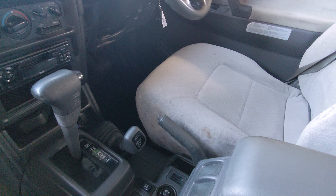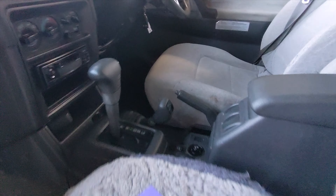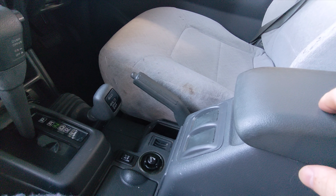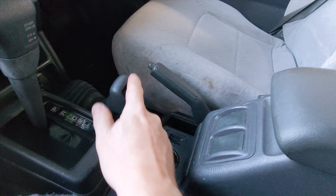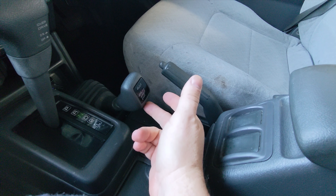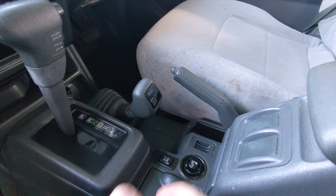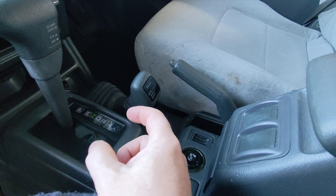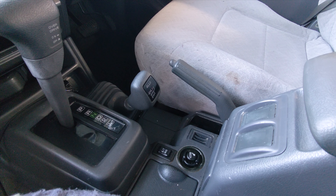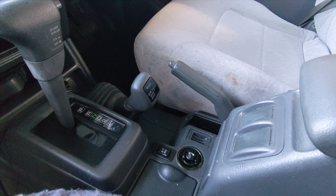Facts about this car — the important things. It has never, ever been in four-wheel drive. So I took the car for a test drive, and the old fella who's 85 years old — the first thing I did was test that four-wheel drive engaged, because as you Pajero owners would know, it's a vacuum-based rod that slides in and out of the front diff, and that vacuum switch is controlled by the controller, and those lines can rot out and whatever.